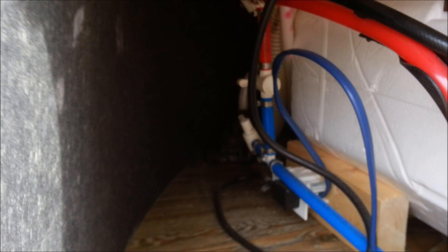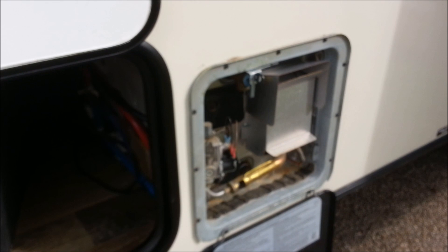...water will go into the hot water heater, but it also circulates through the bypass, and it effectively dilutes the hot water. When you turn the hot water on, some of it is coming out of the hot water heater and some is coming from the bypass, bringing in cold water. So don't forget when you de-winterize to turn the bypass valve off — find it wherever it's located — and then you're going to have your hot water.